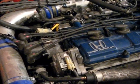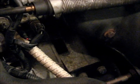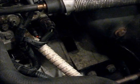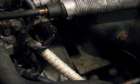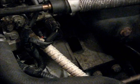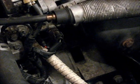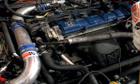Next I'll start the car, hook up the timing light, and shine it through the inspection port, and there'll be a mark on the flywheel. It's red, and it should also be stamped with the number 15, which represents 15 degrees before top dead center. Then there will be 2 marks, one on either side of the 15 before top dead center mark. We want our timing to be within that range, or ideally right on 15 degrees before top dead center. So everything is set up now. I'm going to start the motor, plug in the timing light, and we'll see where we're at.